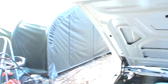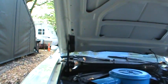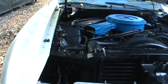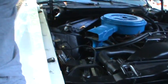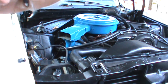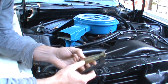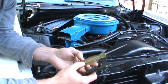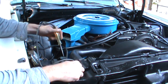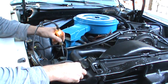Got a couple of things set up. One of them is a little Mustang here. I'm going to get you close to the battery. First and foremost, this is a decent test light — it's a Snap-on test light. It doesn't really matter what it is. All they are is just a bulb with a wire putting power to each side of it. First thing: anytime you want to use a test light, put it across the battery and make sure the light lights up. Doesn't light up, something's wrong with your test light and you're not testing anything.